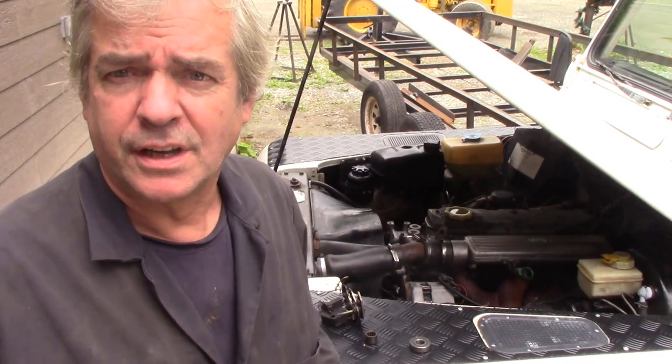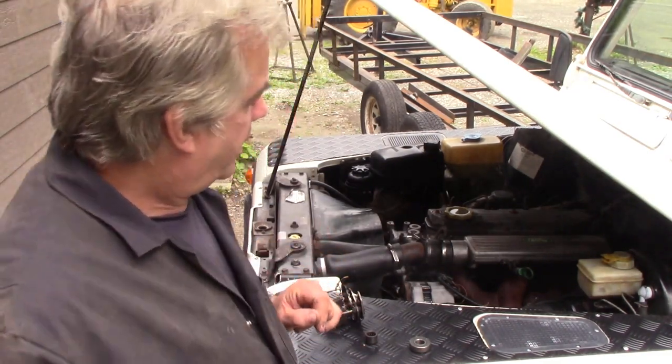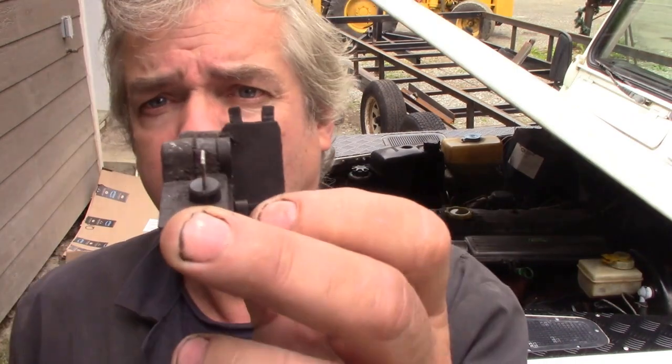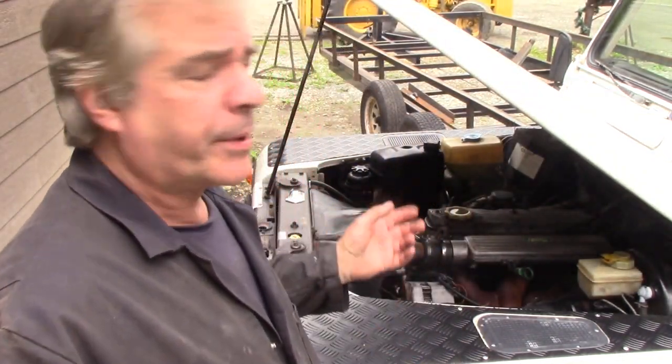This video is about the alternator on this car. I took it down to a repair shop and there was all sorts of things wrong with it as I expected. The rectifier pack was shot, something to do with the diode, also the brushes on the alternator, the regulator pack was no good. They also changed the bearings — this small bearing goes in the end, and this bearing goes on the front cover. I've tested it and it works really well. I lost the files when I was doing this, but it was cost effective.